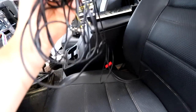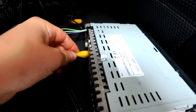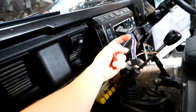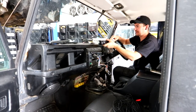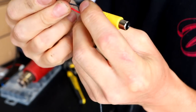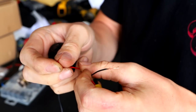So this big long mess of wires is the video feed from the head unit into the back. That's what we need — I need to get this yellow cable routed up and into there. Put that in there. Reverse camera video feed, and then these two are the power: black one goes to ground, red one goes to a power source. I was going to tap into the reverse light so every time you put it into reverse it gets power.